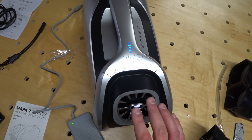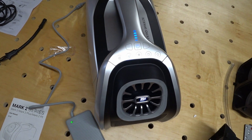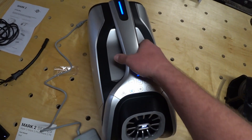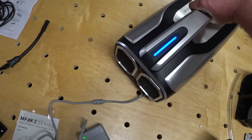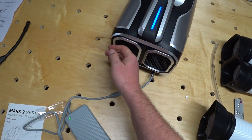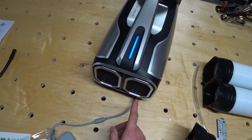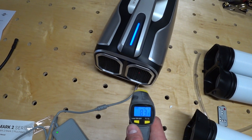There is a built-in thermometer on the front of the unit which was showing 39 degrees at the outlet. I don't know how accurate that is, but the air coming out was very cold. Granted, this was at a 64 degree ambient temperature in the room, and I'll be interested to see how this performs in a sealed up 95 degree vehicle. On the back, the intake air comes in on the unit's left side and the hot air exhaust comes out on the right side. The exhaust port was showing about 83 degrees.